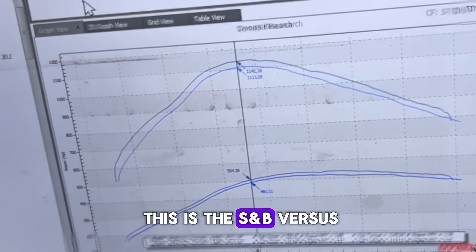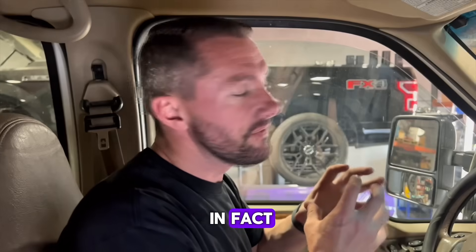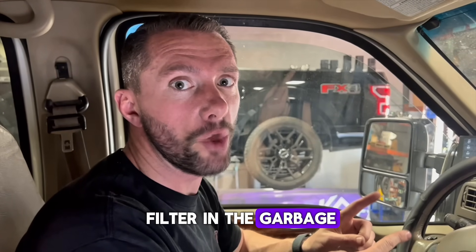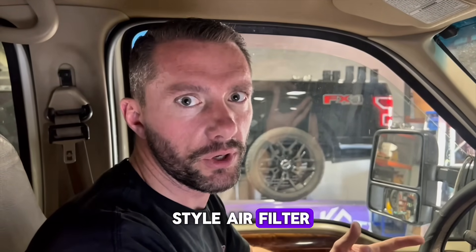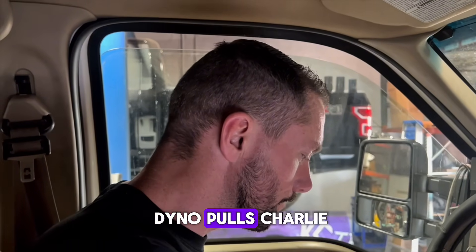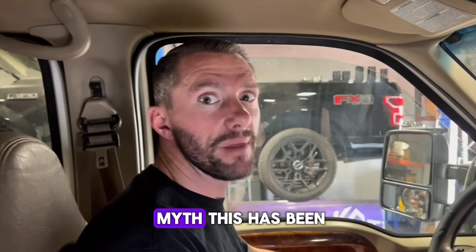Down another six horsepower. This is the S&B versus the 6637 - and that's a brand new 6637 versus an S&B that's been on there for a couple of months. It's ridiculous guys. You wonder why we don't like the 6637 filter - they don't flow as good, they suck hot air, they create more vacuum. We've seen people have EGT problems towing, intake boots sucked closed, poor turbo performance, excess smoke. Throw that 6637 filter in the garbage, put a good filter on there and it fixes everything. We lost 12 horsepower, peak torque went down 38, and that was the first run - in all fairness trucks are always cooler for the first dyno run.